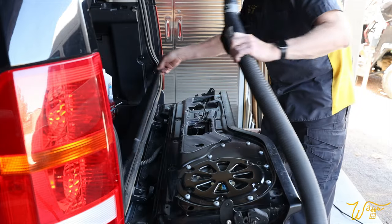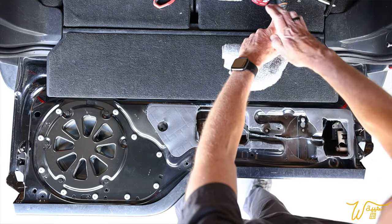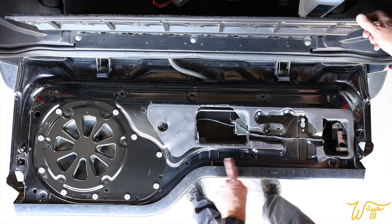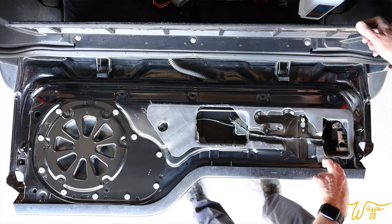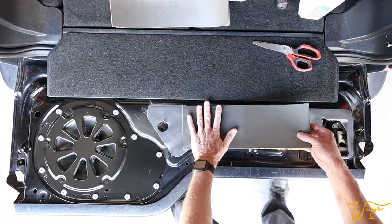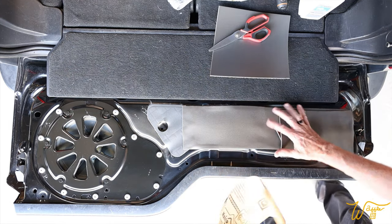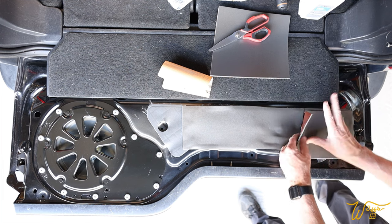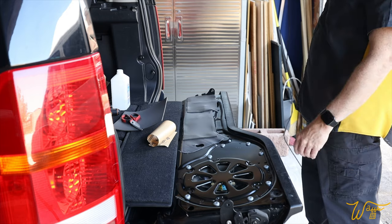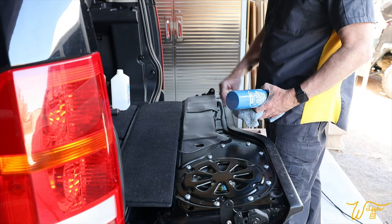Let's clean that up. Quick rub down with rubbing alcohol so I can get some more of that Noiko soundproofing down here — I'm going to use the same stuff to cover this. I'm going to avoid getting any of the sound deadener in these three spots because the panel clips are going to go in there and I don't want to fight through this stuff. I don't know if that's any quieter, but it makes me happy. Lastly, I'm just going to clean up everything around here before we put the panel on, and then let's go repair that broken piece of the panel.